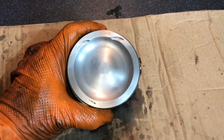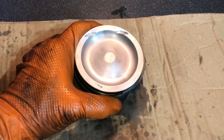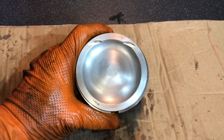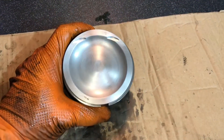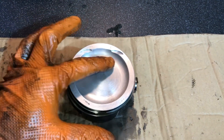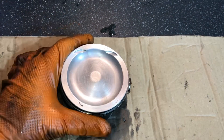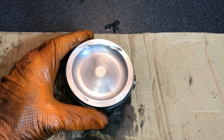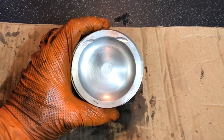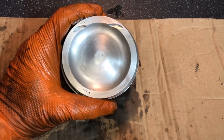After a little bit more cleaning, you can see the piston is absolutely spotless of carbon. Everything is cleaned out in the valve cutouts, there's no carbon buildup at all, and there's no damage to the piston — absolutely perfect. Most people would want to stop here and just put the head gasket back on and run the engine, which is absolutely fine. But for high-performance engines, carbon will build up again very quickly because of the matte finish. A mirror finish on the piston will help a lot to stop carbon buildup. Carbon causes detonation by raising compression, and over time you will get knock.